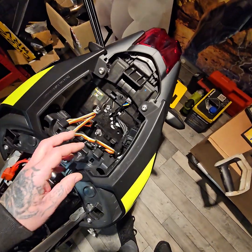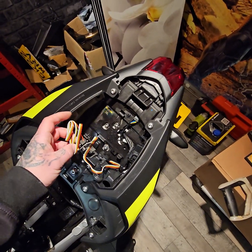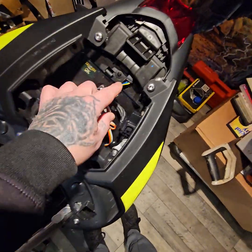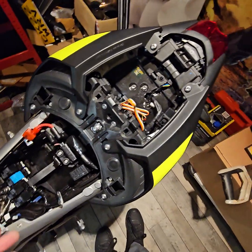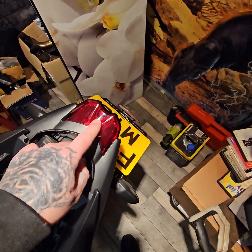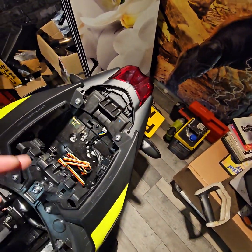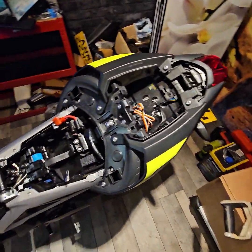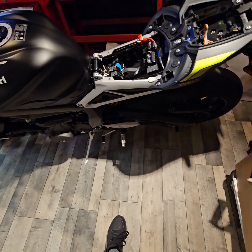And then, like I say, I've got the True Track off eBay. I think they're about £25. This is a True Track Pro. Pretty decent company. I've got one on me YZF-R over there as well, but it's not the Pro version. But I'll give you a bit more of a rundown about what wires, because it's probably going to tap into one of these instead of an ignition. It's just to tell the tracker that the bike's on, the ignition is on. The only time you're going to get this light on is if the ignition's on. So it's an easy way, rather than tapping into an ignition wire, just tap it into like a tail light. So that tells the system that a light's on, which ultimately means that the ignition's on. And I'm going to get a smaller number plate for it as well, because it's got that big massive thing on the back. Other things that I'm going to be doing to it, the peg delete, not a lot really.